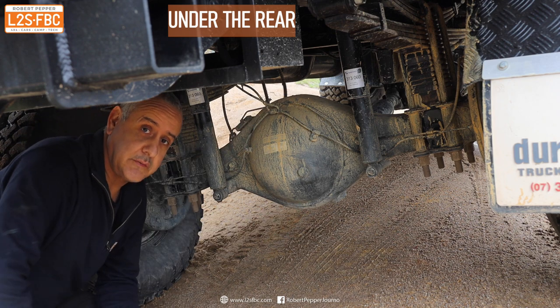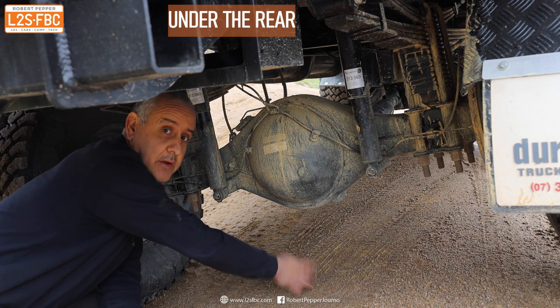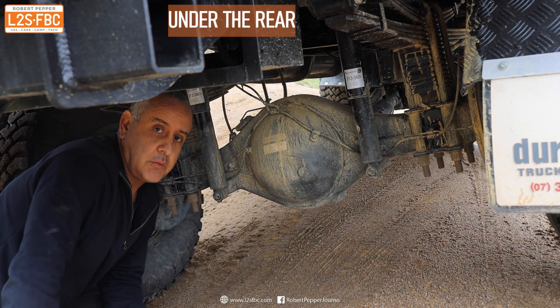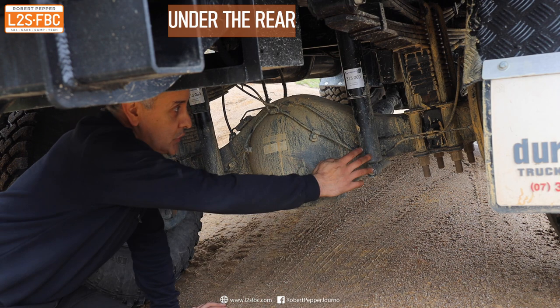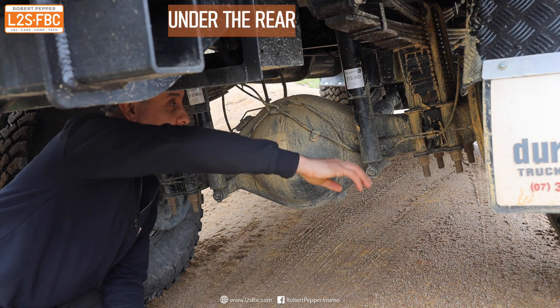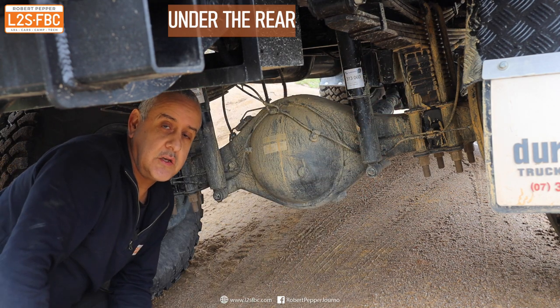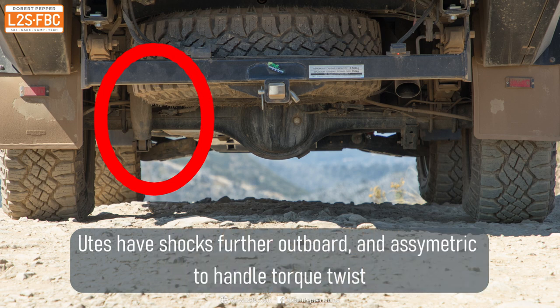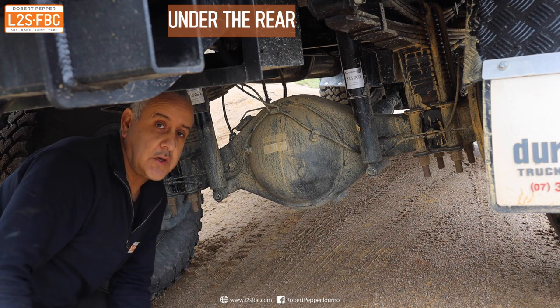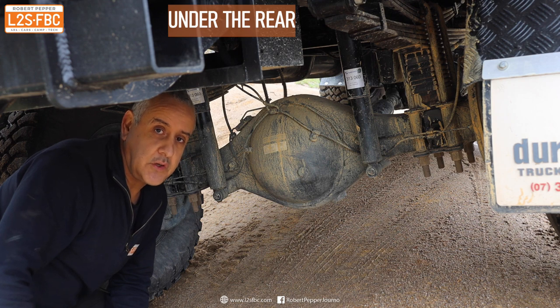Underneath, look at the size of this differential — it's massive, really designed for heavy duty, and that's what starts to limit your ground clearance. The shock absorbers are actually quite close to the differential; for maximum ride and handling you want them out as far as you can, but they're quite inboard here. Combined with these massive leaf springs and the lift, you're not going to get the ride and handling you would out of a modern four-wheel drive. It's also a live axle, and bear in mind you're right over the front axle, so if you're looking for maximum comfort this is not the vehicle for you.